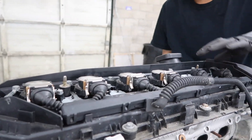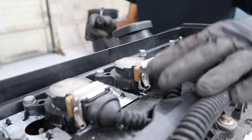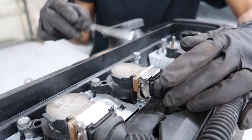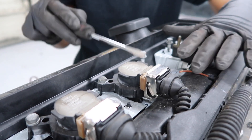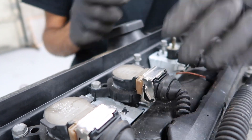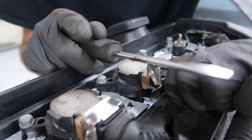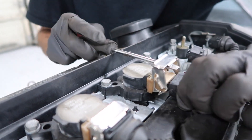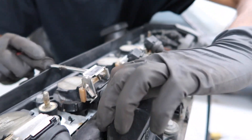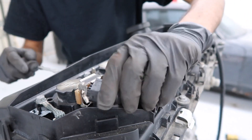I've already removed two of the ignition coils and spark plugs, and we're going to remove the other four. First, you're going to unhook all the ignition coils. Depending on what engine you have, you might have a different style ignition coil. If you have a triangular one, you just lift the little tab up and pull out to release the connector. On this one, you just release the clamp and pull the connector out.